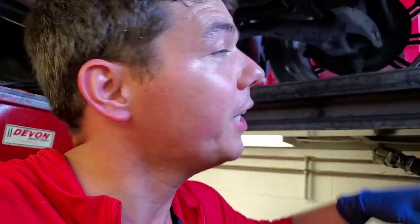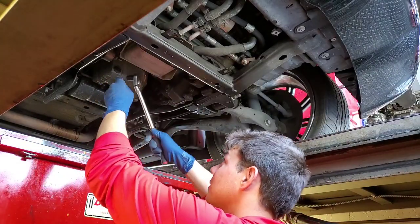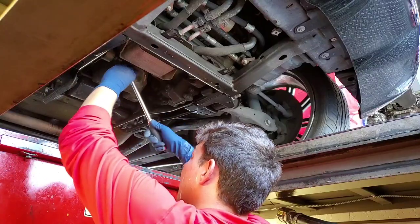I'm going to answer the question first — any residual flush that gets left in, that half a quart, it won't hurt anything. A lot of people always ask me that. So absolutely nothing to worry about. Let's drain her down — a 13-millimeter socket, same exact thing as all the belly pan bolts. Now all we do is just crack her loose like butter, and now she's super hot so it's going to come out like water.